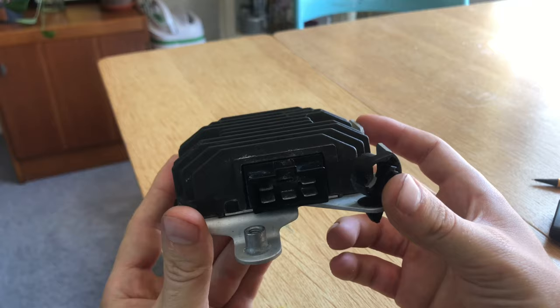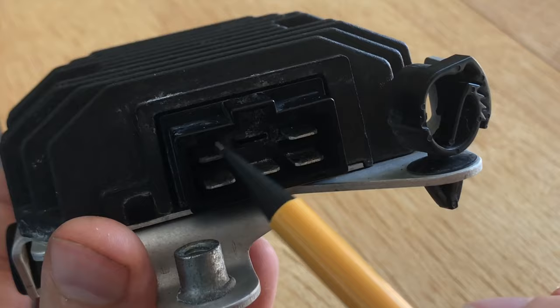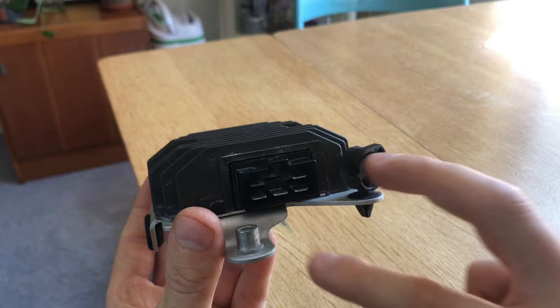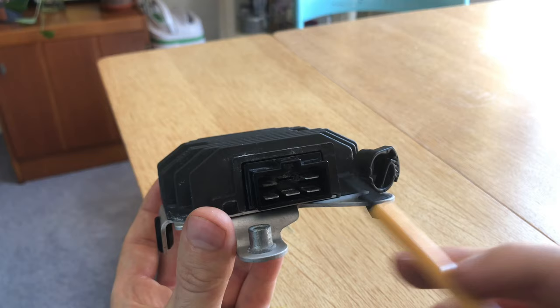In this case we have a three-phase regulator rectifier, which is the case for all bigger bikes. If you've got multiple cylinders, lights and all that, it will be a three-phase rectifier, so you can use this method for all of them. You can tell it's a three-phase if you have two power nodes — positive and negative — and then three phase nodes. In some bikes you'll be testing the wires that come off this, but on the FZ6 you test it on the rectifier itself.